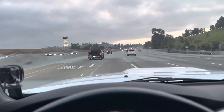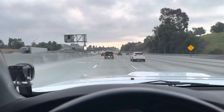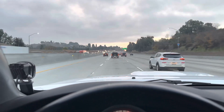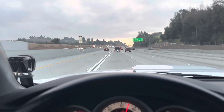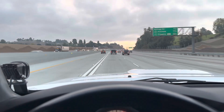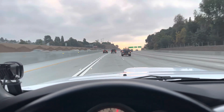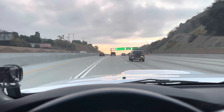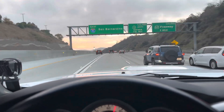At some point this truck will get re-geared, but it doesn't really need it to be honest. Right now with the spacer, the negative three-degree exhaust cam gears, and the tune, the truck feels great. There's really no need to tear apart the diffs right now until I have either a gear failure or step up to an even bigger tire size — but I don't really plan on going past 35s with the setup I have now.